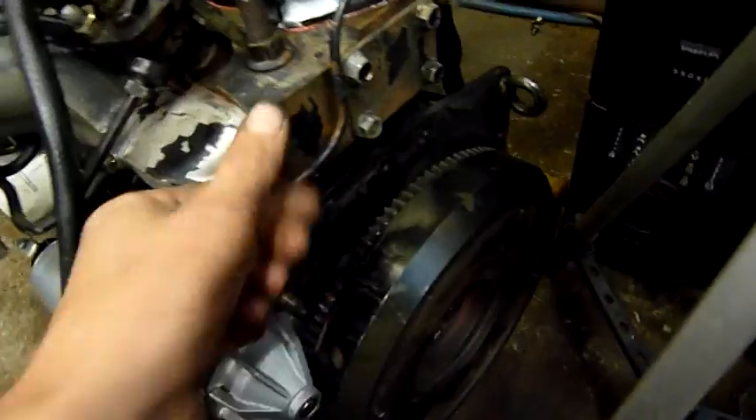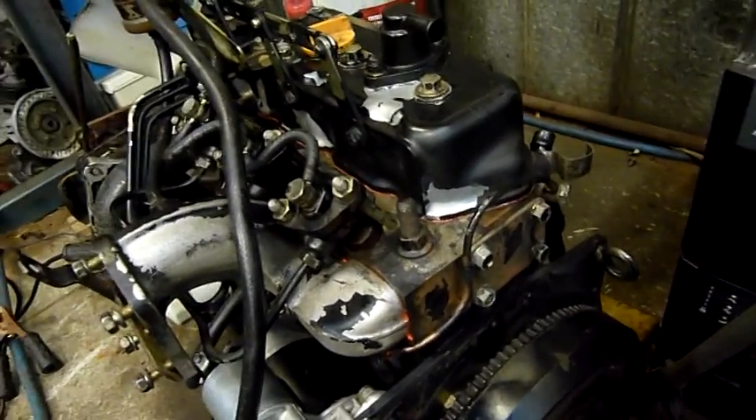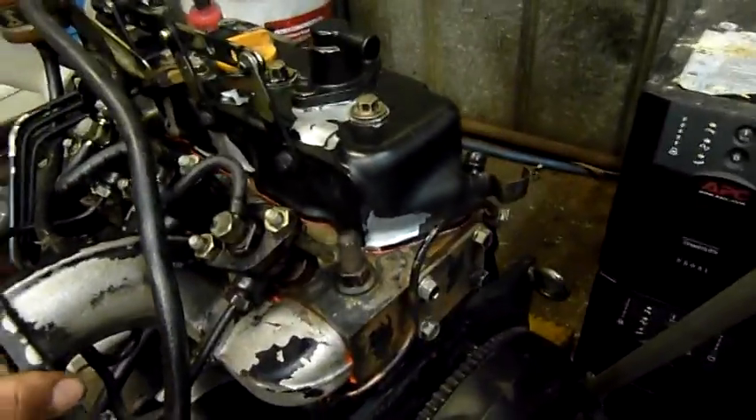You can wipe the excess sealant away — it's called flange sealer. It's pretty good stuff but the excess doesn't harm anything; it just looks a bit ugly with the pink. The other option is a mastic sealant type stuff — Blue Max or Copper Max. My tube of Copper Max went off which is why I'm using this stuff, but I'm going to get some more Copper Max actually. For now this will do.